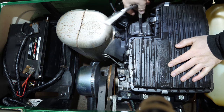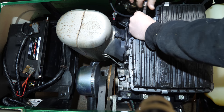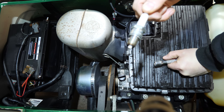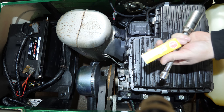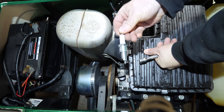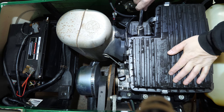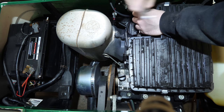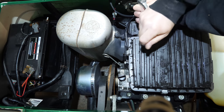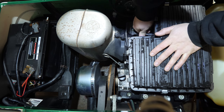Change the plug. The spark plug wasn't very tight. The plug's not all that bad. I only use NGK plugs — BPR-2ES, already pre-gapped. Brand new plug going in. That spark plug did not come out with any resistance — I wonder if he was having running issues.